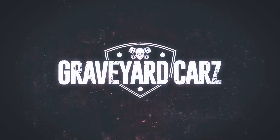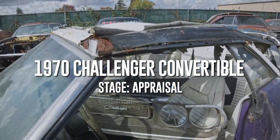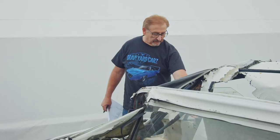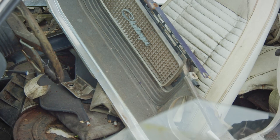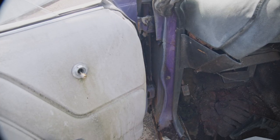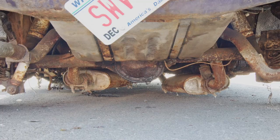The unburied dead are coming back to life. One of my clients has had a car here for a long time — a '70 Challenger convertible. Tony's still here so I want to use his brain and his expertise. I want an honest, open opinion on the parts for this '70 Challenger convertible. Come in here and take a look at how the seat's leaning. That's why the seat's leaning — there's nothing there. I knew it was rusty when we took it on. I was more optimistic three years ago when it came in than I am today. I work on these every day and I know what goes into it. At the end of the day, I can't even use the hinge pillar — it's rotten down at the bottom. So there's nothing to build off of.